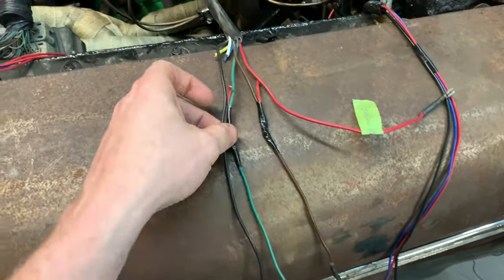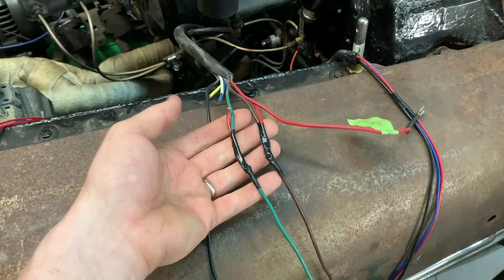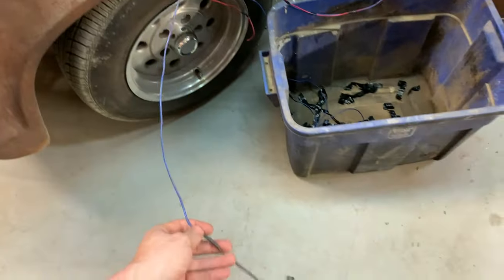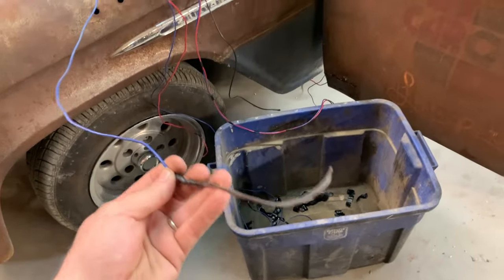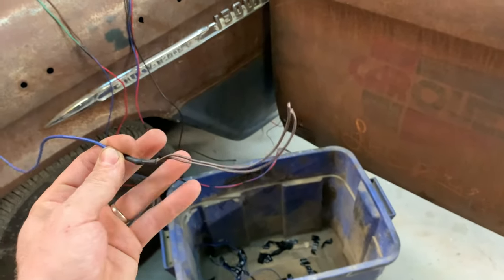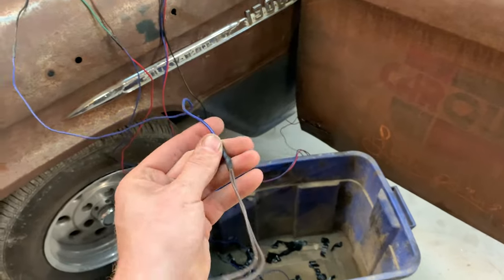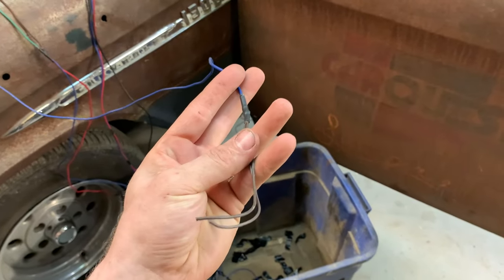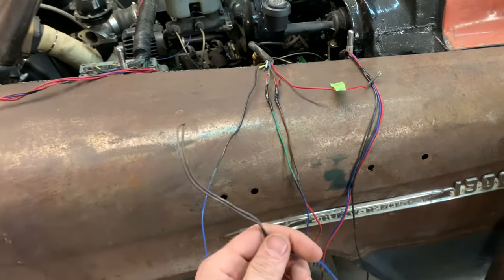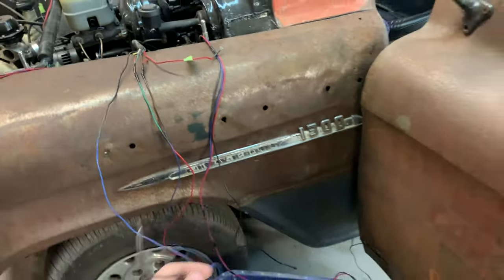And I'm like 95% sure this is my signal light switch here. And this is either, I think that's a power actually. It should have been going to a fuse block. That's why it has two wires on it, because I got a heavy gauge wire here and two lighter gauge wires going into the fuse block. So that should be power, but to where I cannot remember.